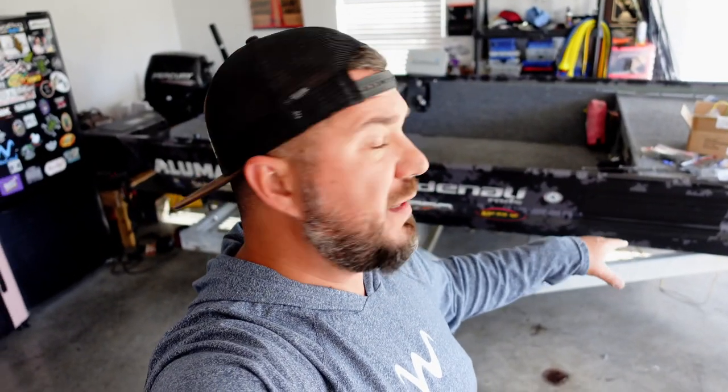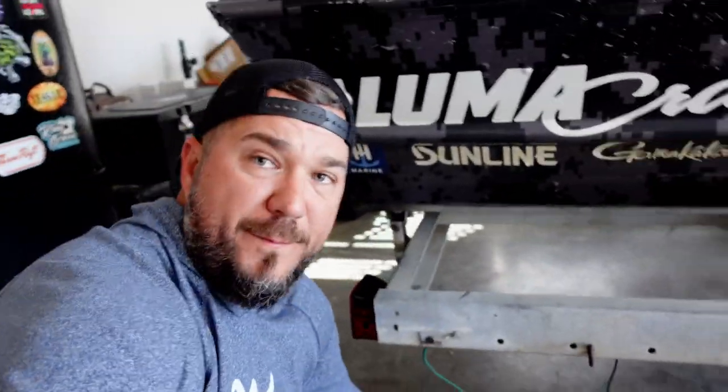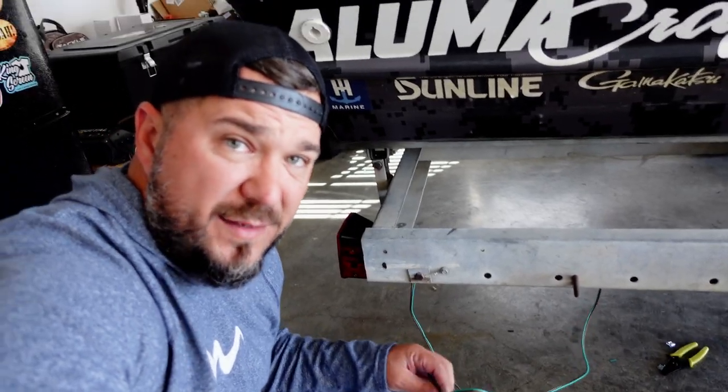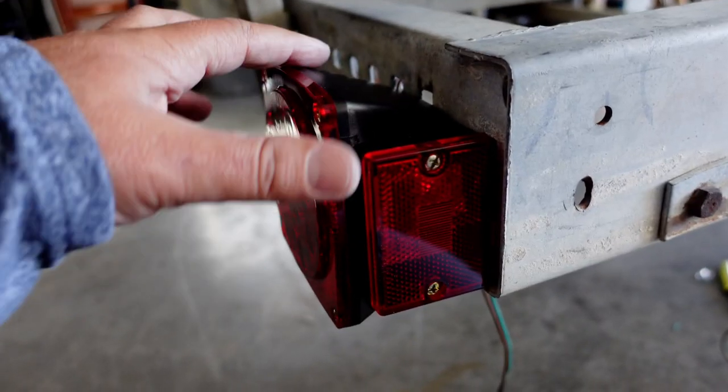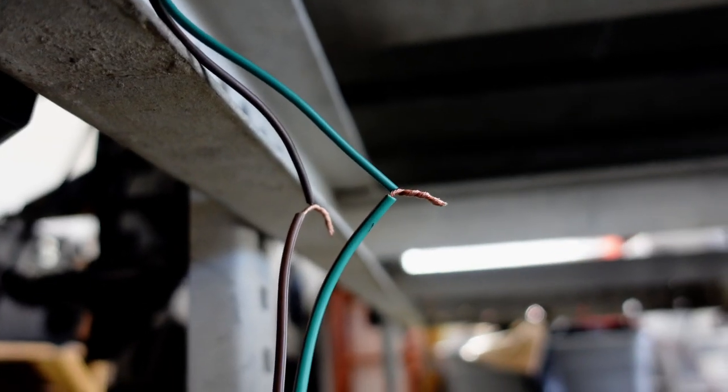I've got the whole right side of my trailer wired up — the running light is hooked up, all my clamps are in so the wire sits nice and tight with nothing hanging. I left some slack as you can tell. I've got this tail light hooked up but no wire nuts on it yet. I'll test it first before cutting any wires in case there are problems. I'm going to set the camera down and test the running lights, brake lights, and signals.